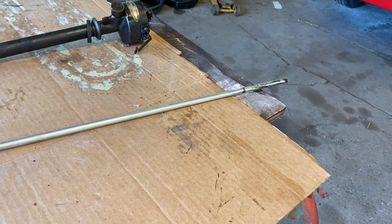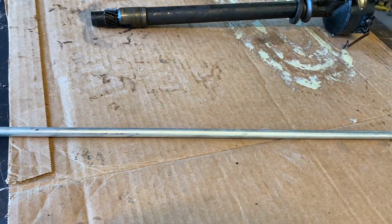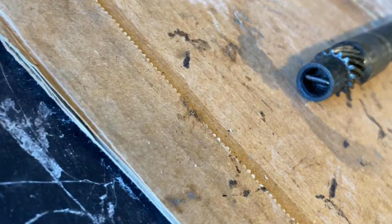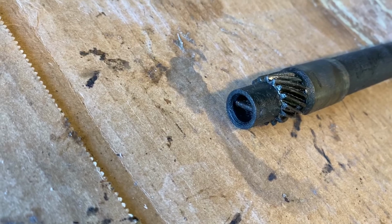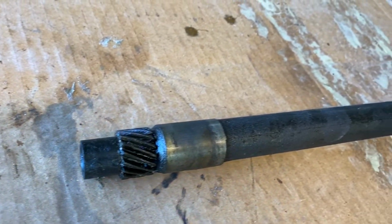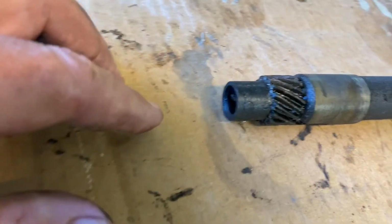So we picked up a piece of bar stock, quite long, we'll probably shorten that up, and we need to make an end to go on it that's similar to this distributor end, so it will have a pipe and a roll pin. I thought about grinding a flat on the end of the bar stock, but I'm concerned about the potential of breaking the ears off on the oil pump, so we don't want to do that. So we will see about getting something approximately that diameter with a roll pin across that we can get down into